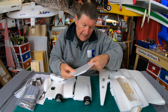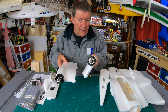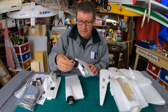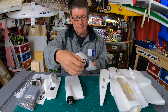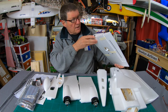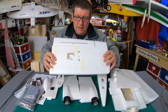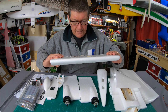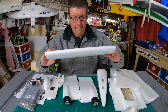The sections with the motors are already mounted — they're 2205 CA 2300kV, nice little mini-quad style motors. Just look at that airfoil — it's a very thick airfoil, so it's going to be good for flying slow. I can't even bend this wing; this is going to be super tough. There are nice plywood surrounds for the aileron servos, and some nuts in there to screw the servos into.